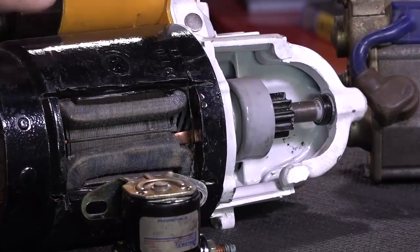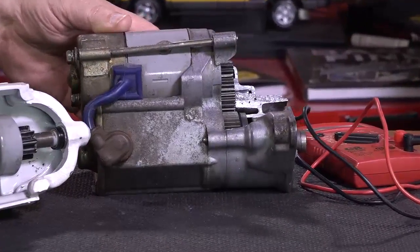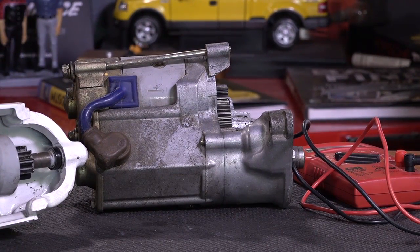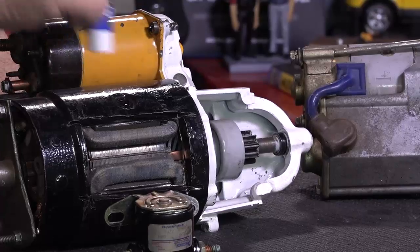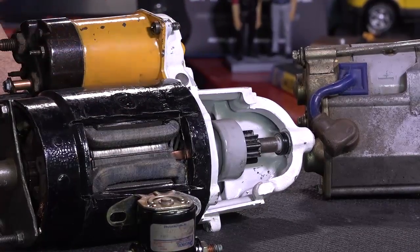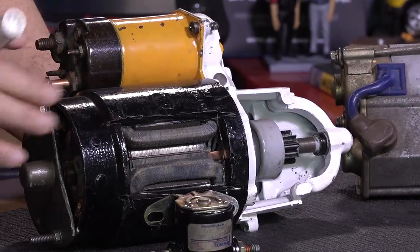This is the way starters used to be, and this is the way starters are today. Look at the difference in the size of them — it's an amazing difference. The reason for that is that most of these modern starters have permanent magnets in them; they're permanent magnet motors. In these old ones, they have big coils inside this heavy body — either wire or bar wound coils — and they take up a lot of space and transmit power into the body. So you have to have this big massive body in order to get the power to start the engine.